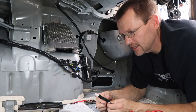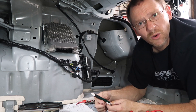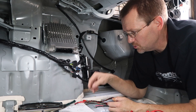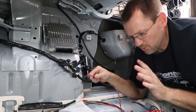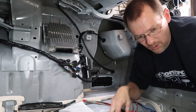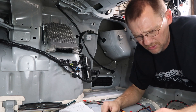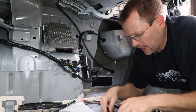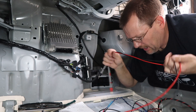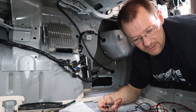The last thing we want to test is whether there's any fake engine noise, automatic noise cancellation, or anything else from the radio that might affect us. To do that we're going to plug in the RTA, focus on the front speakers since those are typically the ones that carry the noise, and then shut all the doors, roll up the windows, and see if we get any signal silliness.